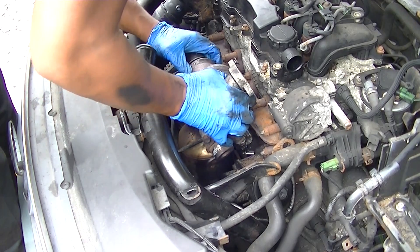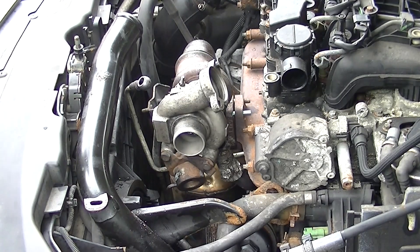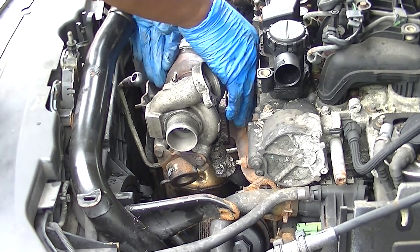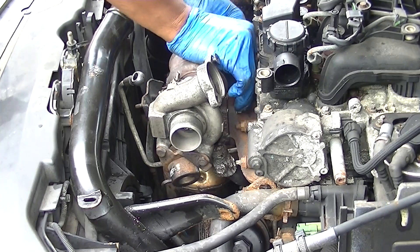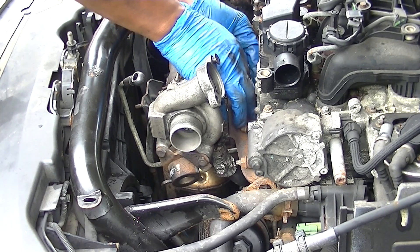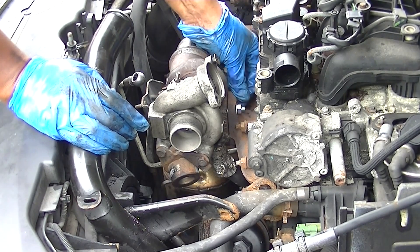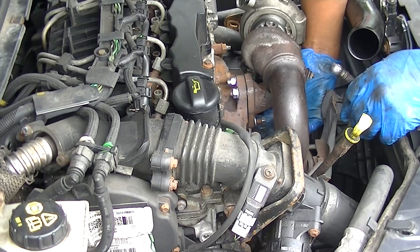You can see lining up the brackets is pretty easy because it's all front-mounted. You can see the bolts going into the actual manifold themselves. I replaced the nuts because the other nuts were broken and a bit bent from the heat. If you're going to do that, just put a washer and a nut — it's a normal BSP thread, I think it's M8 bolts, but you'd have to check yourself.